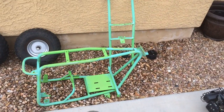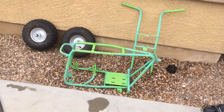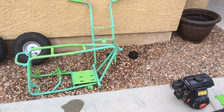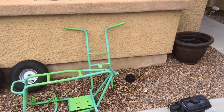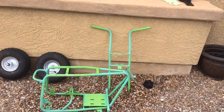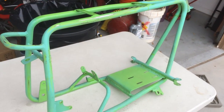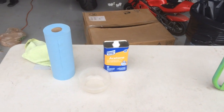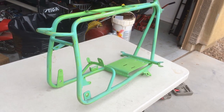It's been roughly five hours since I began this project of disassembling the Baja Doodlebug. I'm now at the point where I'm letting a few pieces dry after hosing them off following the fine sandpaper sanding. I'm going to use acetone to wipe down all the metal parts to make sure they are as clean as they can possibly be before the final phase of painting. I went with a shiny black paint. I've let all the pieces dry and now I'm going to use the acetone, clean off all the metal parts, allow them to dry, and then begin the painting process.